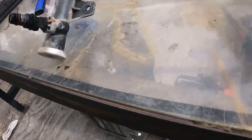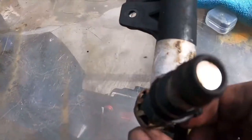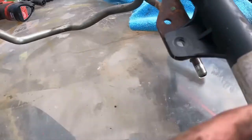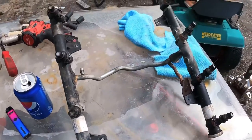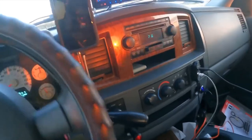So I assume, I haven't taken injectors off of a vehicle like this, these little clips here pop off, and then the injector should just be able to pull right out. So until, yeah, I will see you guys soon. Clip. We've got the injectors.